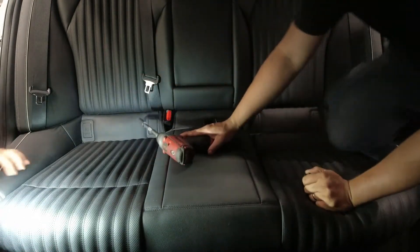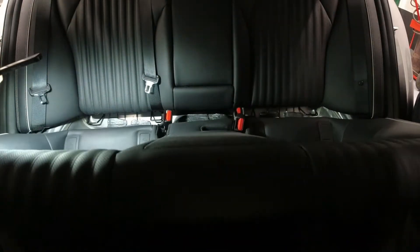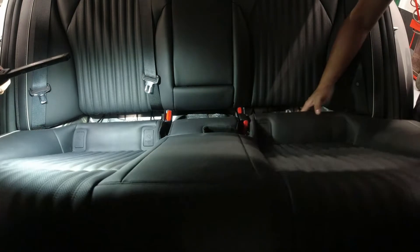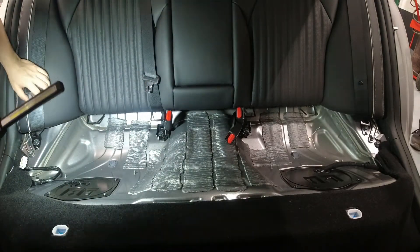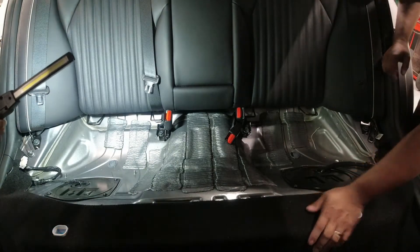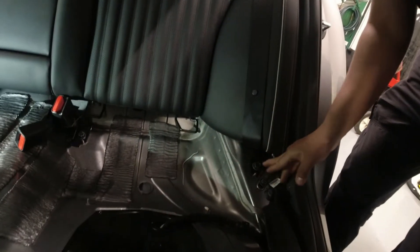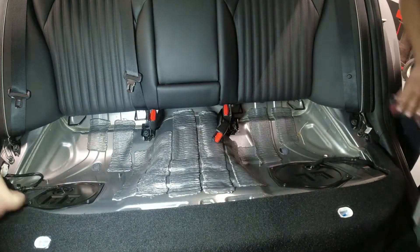The other one is out. Now we can pull this seat out slowly. Since it's Genesis, they have heated seats, so there should be a connection on that side. Remove that connection. On the corners, as you can see, there's one here — that's for our mounting for the back seat, and the same thing on the other side. We're just gonna remove those, it's the same 12mm.